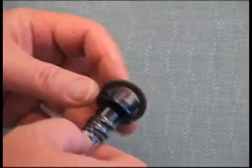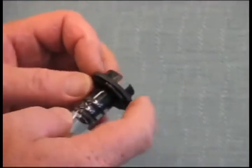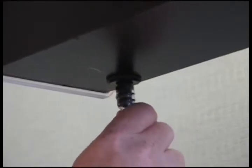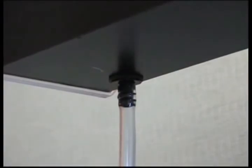Next, place the foam washer over the top of the fitting and position it evenly all around. Insert the assembled drain tubes into the holes on the bottom of each end of the canister. Push straight in until it clicks into place. Pull down to test the proper fit.